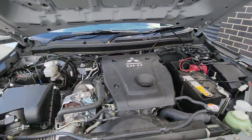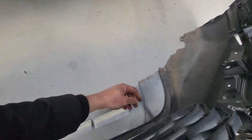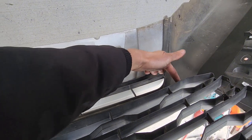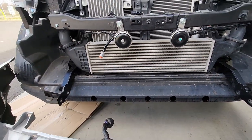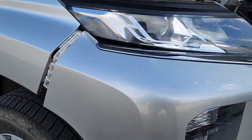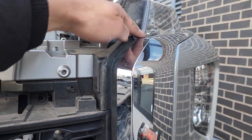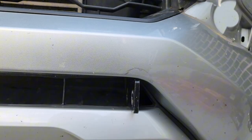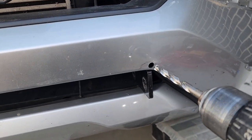The last thing is we'll neaten up the wiring. Put the bumper up here to locate it and see where these come out of — from testing it, they come out right about here. I'm going to try not to cut as much as I can. The drawing suggests cutting out quite a large part, but I'll sit it up, poke it through, cut around what I need to, and see what access I have for the bolt. I've gone ahead and slid the bumper bar on the two arms — you can see it doesn't quite fit perfectly, it's a tad high. We're going to mark just above the arm and cut it so it fits perfectly.